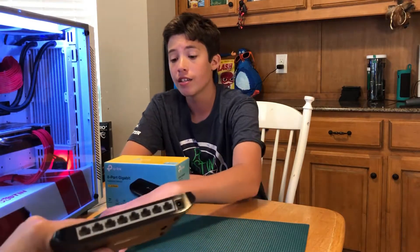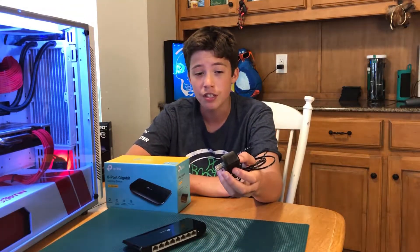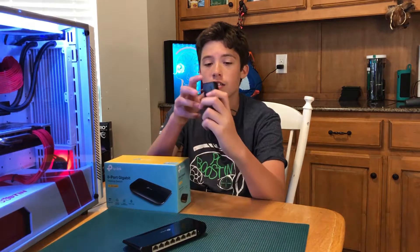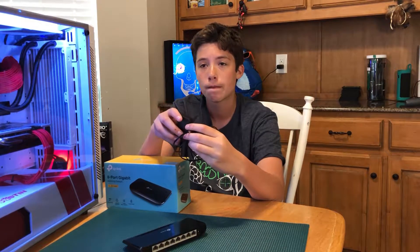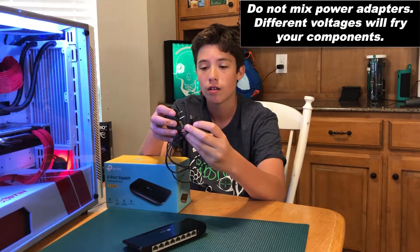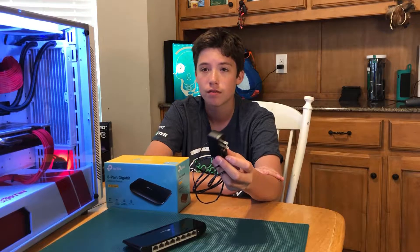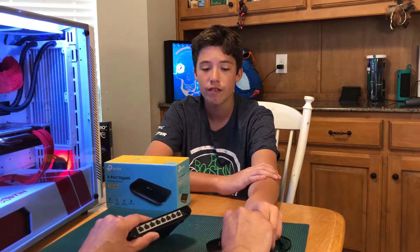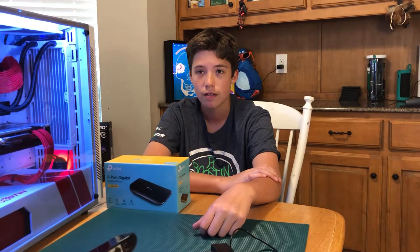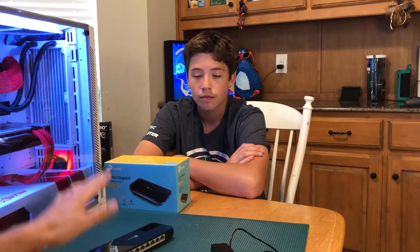What is important, though, is the power adapter. You never want to mix them up, because they can be different voltages. These are AC to DC — they plug in the wall. Different manufacturers can use different voltages, and different currents won't make it work properly, but the different voltages will fry it. I've done it. Don't be tempted even if the plug fits — even if it looks like it's going to fit, don't do it. Don't be lazy, don't risk it. Go ahead and run the new one that came with the box.